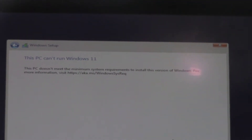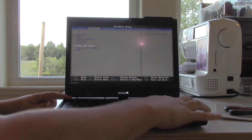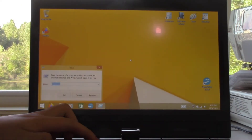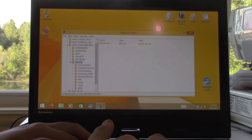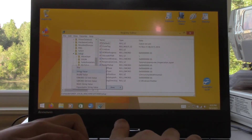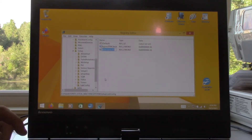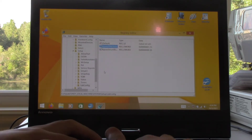That is exactly what I expected to see. I went into the BIOS to make sure everything is set up correctly. I know this looks like the BIOS, but this is really a UEFI system — the UI just looks something straight out of MS-DOS. I scoured every UEFI setting, then rebooted back into Windows 8.1 to do my first registry hacks. I go to HKEY_LOCAL_MACHINE, SYSTEM, SETUP, and add a new key called LABCONFIG. Then I create two 32-bit DWORD values: the first is BypassTPMCheck, which does exactly what it says, and the second is BypassSecureBootCheck. Set both of them to 1 and I'm good to go.